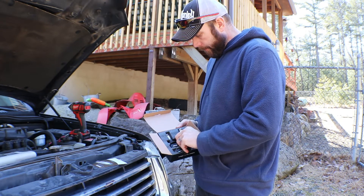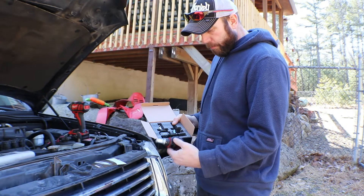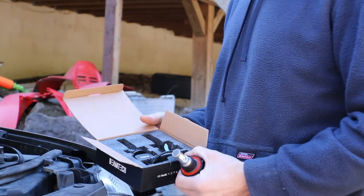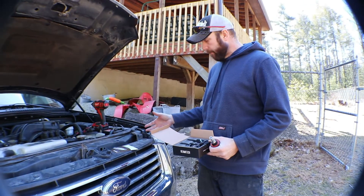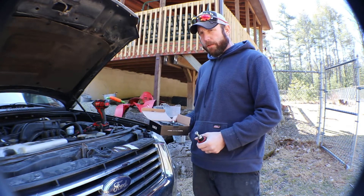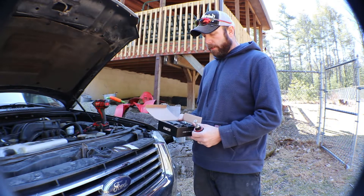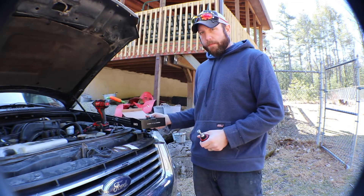Pretty much plug and play. I always like to buy bulbs that are adjustable because depending on what kind of headlight you have, you can always adjust the beam to be just right. In these Ford Explorers, you have two bolts — two 10 millimeters — on top, and you've got to take those out and slide the headlight out to put the bulb in. These are also CAN bus ready, which means they won't give any false signals to your computer saying the headlights are out.